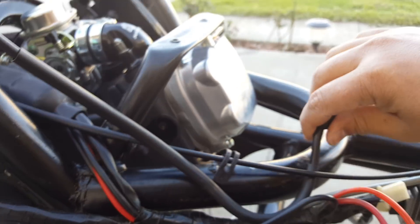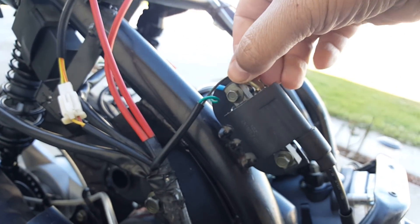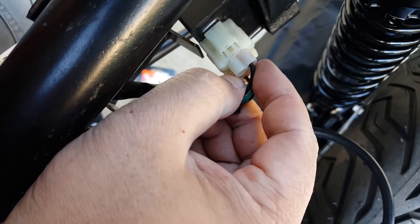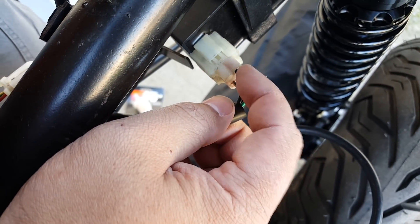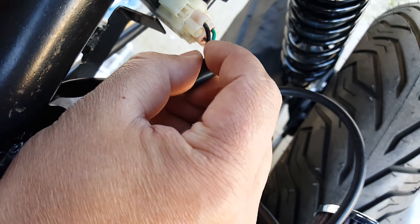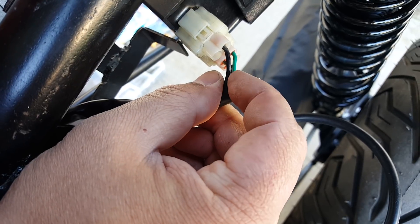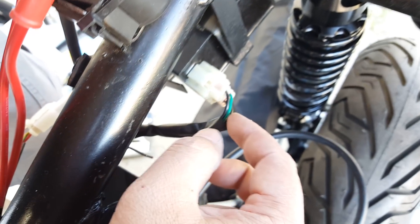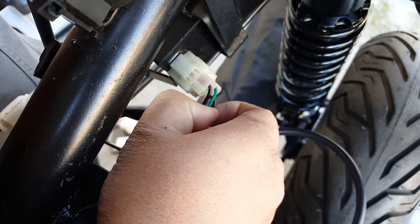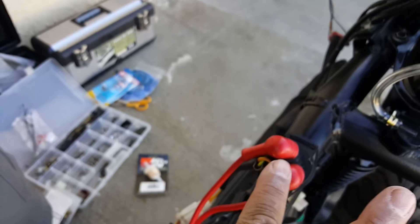All these products will be in the description. This is the coil wire right here — we're going to remove this whole unit. On the DC CDI, the power wire is the black one. I know, normally you'd think power is red, but with Chinese wiring they don't really care what color is what. So your 12-volt positive battery wire is the black single one, your ground is the green wire, and the blue wire is your stator pickup — it's going to tap into the black and yellow wire. On an AC unit it might be a little different.